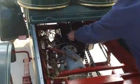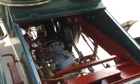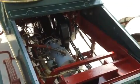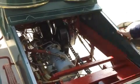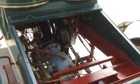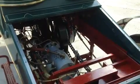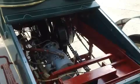At the end of each day's touring, I remove the crankcase cover and I grease the main bearings, the big end bearings, and I check that everything's all right in there. Every couple of days I put grease in the transmission. There's about 8 different greasing spots in the transmission. It doesn't have any seals, so it would never have held oil. And I just check everything out generally.